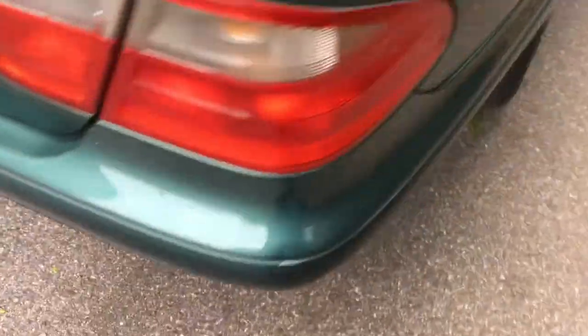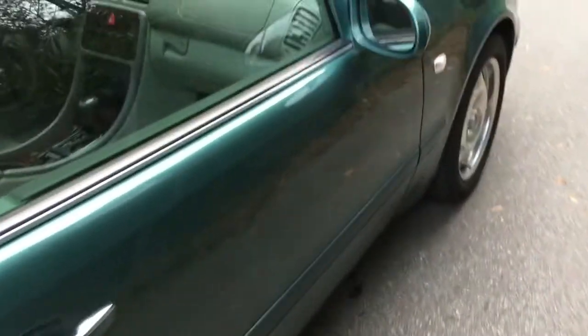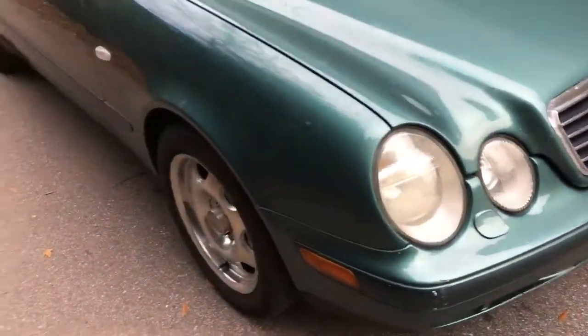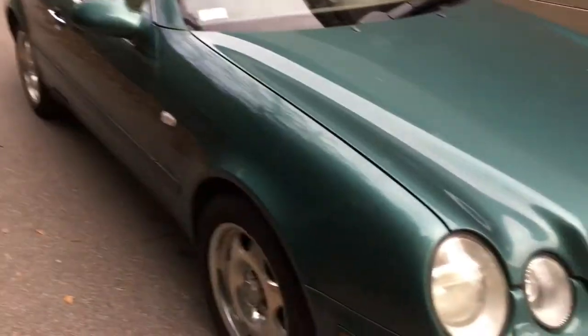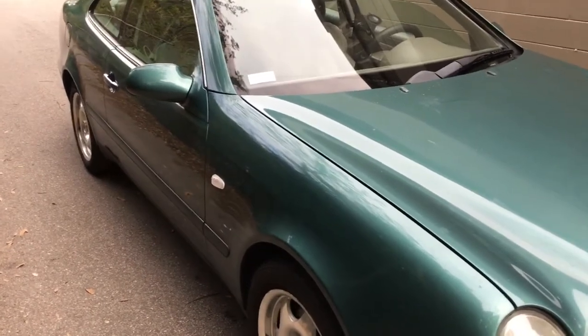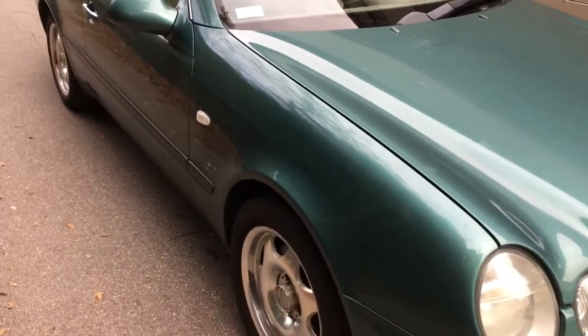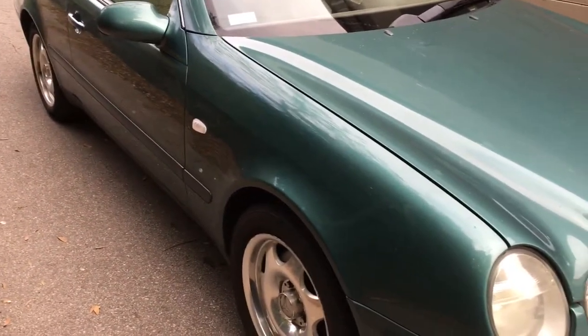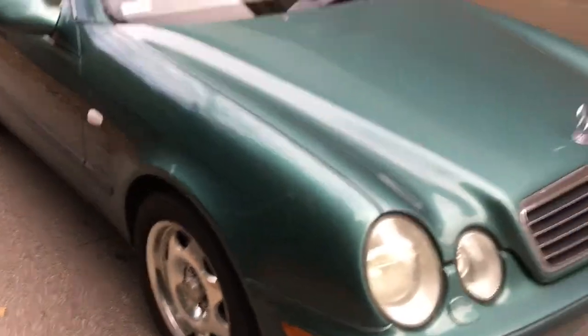Interior. Everything is fine on it. So I'm gonna just go ahead and replace the conductor plate and rebuild the valve body, and I'll maybe replace the TCM, or maybe just flash it, or maybe just clean it out. It's probably full of oil or something. Maybe oil wicked up the harness into the TCM. But we'll see what happens.